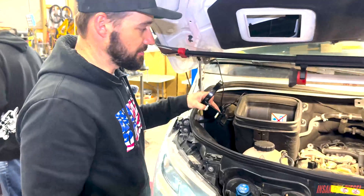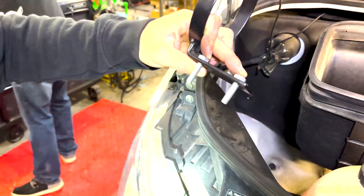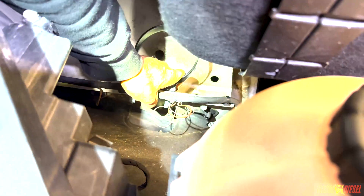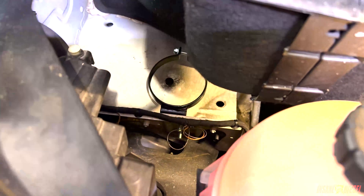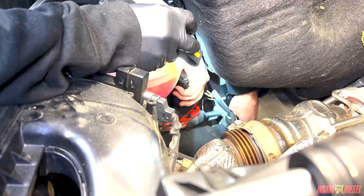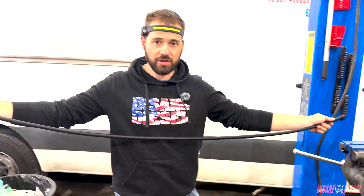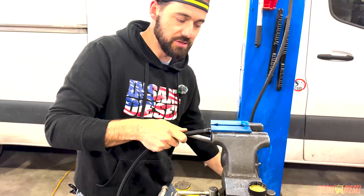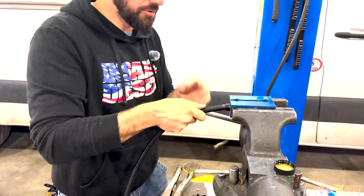Okay, we found the perfect mounting spot. These are 5/16th bolts, and there's actually 2 pre-drilled holes in that white metal bracket. So we'll throw some nuts on there and mount our canister right there. Your pressure line is 6 feet long — 72 inches. That'll go from the top of your filter cap to the bottom inlet of the bypass filter.